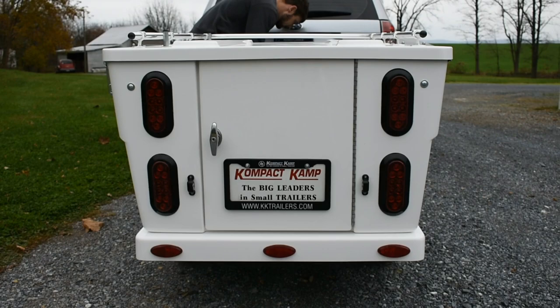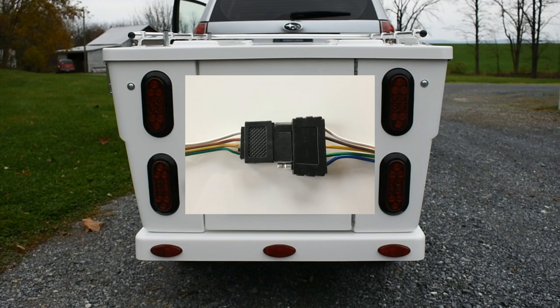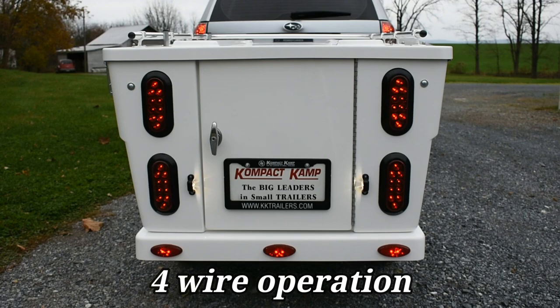Now we're going to hook it up to a flat 4. The great thing about a flat plug is you can plug a flat 5 trailer plug into a flat 4 plug and we'll see how the trailer will operate as a four wire system. Again, all the lights will illuminate with the running lights on, but your functions are going to be through the bottom lights only. So you have your right turn, your left turn, but then your brakes are also going to operate on those bottom lights. This is completely legal and it's how all flat beds and utility trailers operate, but you can see that there's less lighting when you have a turn signal on and you're applying the brakes.